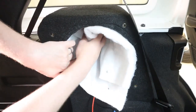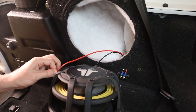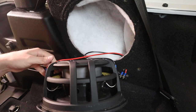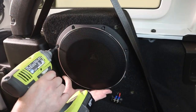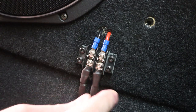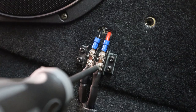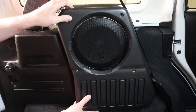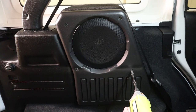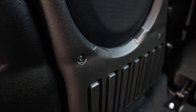We can now reinstall the batting material. We reconnect the subwoofer wiring, making sure the red wire is connected to the positive terminal and the black wire to the negative terminal, and reinstall the subwoofer using the eight subwoofer mounting screws. Now we connect the speaker cable to the barrier strip on the front of the enclosure after running the cable as necessary. We then reinstall the trim panel using the four M6 socket flanged button screws and a four millimeter allen — these only need to be snug, do not over-tighten.